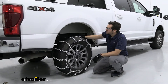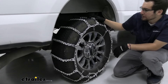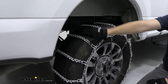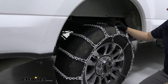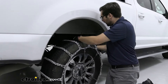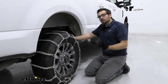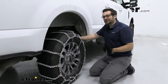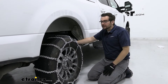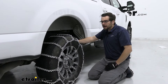We also have a ladder-style chain here that basically gives us what I like to call a hills and valleys function. These cross chains are going to be creating our hills, while the open tread on our wheel is going to be our valleys. That gives you excellent start and stop capabilities because you have each one of these to come over or to help you slow down. To that end, you are going to lose a little bit on your turning radius because as we make lefts and rights, we have to overcome these hills every time, which requires just a little more acceleration. It's not the worst thing in the world, but it's definitely something to keep in mind as you're mounting up your tire chains.